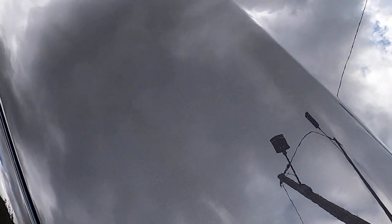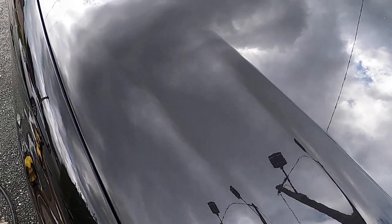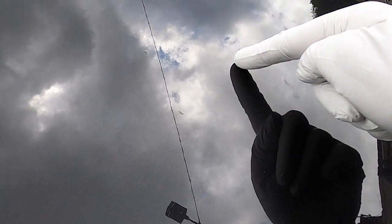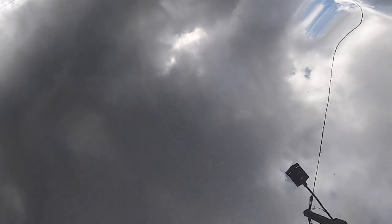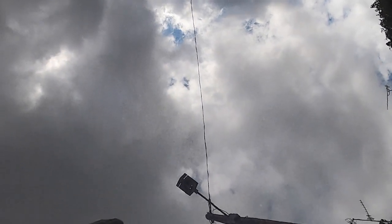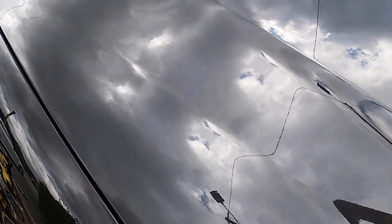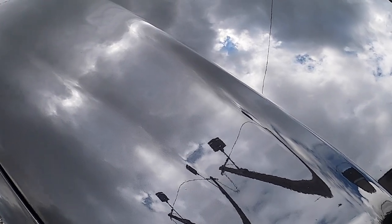So guys, that's that half done, that half not done, and before we even get the hose out, this has actually been left for just over 2 hours, but you can see a definitive line there. You can see it moving there. That's where the product stopped. It's a ceramic reloader, but it also definitely enhances depth of colour, and that really is quite noticeable. You can see the mark there. It really deepens the colour, gives it that wet look effect that we're all after.